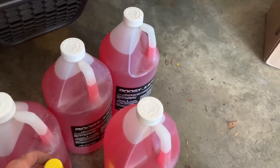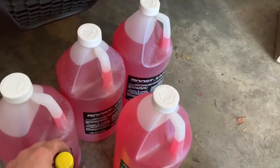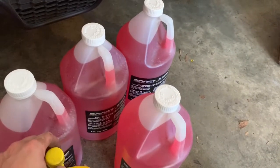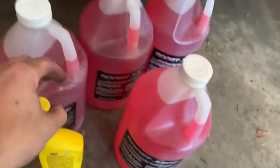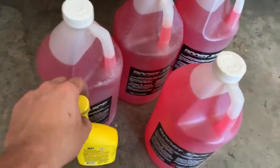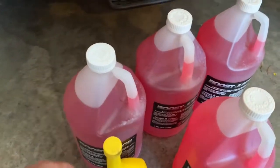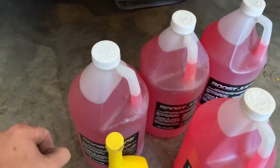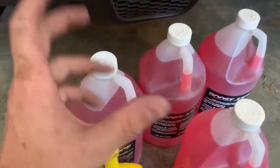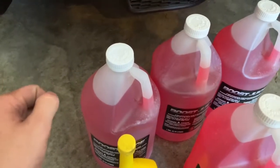Now if I want to save a little bit on the fluid, I'll turn that up to spraying around 12 psi, just because I have the bigger turbo so I have a little bit more boost — so 12 to about 28 psi. I try not to push the car that often, but if I do happen to push it, I'll change the settings on the fly, which is great about the AEM kit. That's probably my favorite part — the module itself is fantastic. You can easily change it on the fly, super simple.